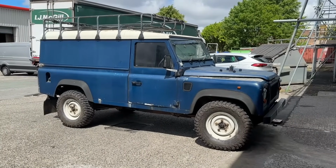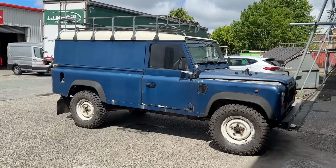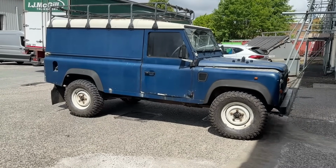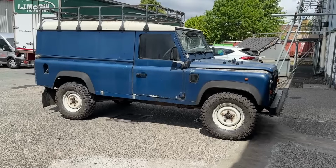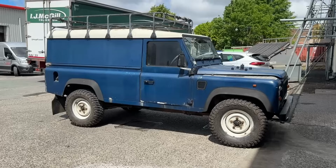So I know you're thinking, what a shame that we've lost those boost alloys, but to be honest, I really prefer the steel wheels on there. I think it looks just right now. I've kept the BFGs, really nice. I did just get offered some Conti cross contacts, which I'm tempted to possibly try out. But with those wheel spacers, I've solved my rub on the radius arms, so I can get full lock now, no rubbing, which is great, which is why I like those wheel spacers so much.